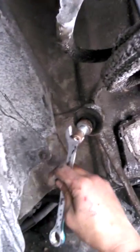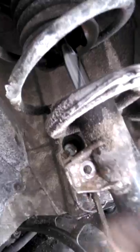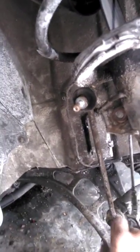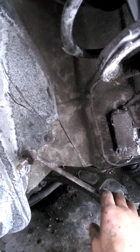You don't want to drop the whole thing. There's also this one right here — it's a number 16 nut — and that's for your sway bar link. To remove it, you hold the back right here and you're able to release the nut on this side. Another thing I found out is that these sway bar links are way too long, so I'm gonna have to get shorter ones.